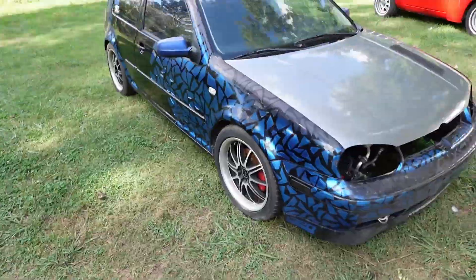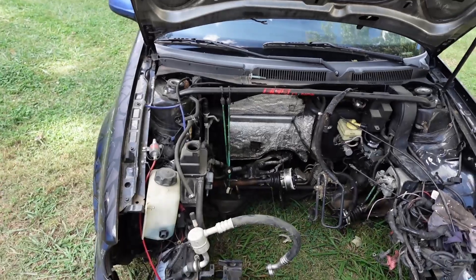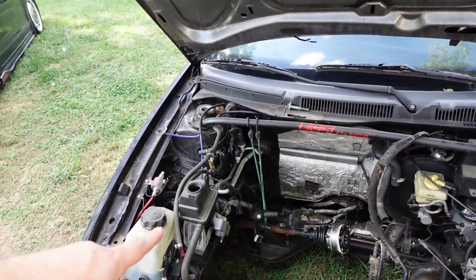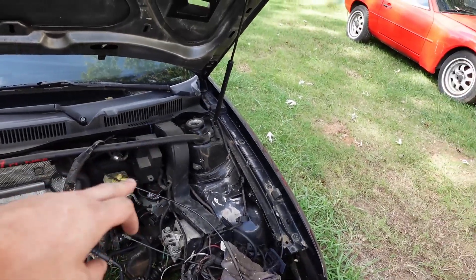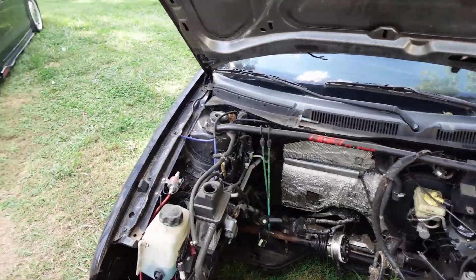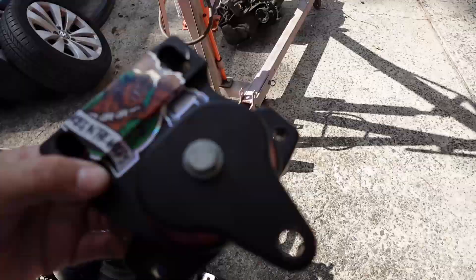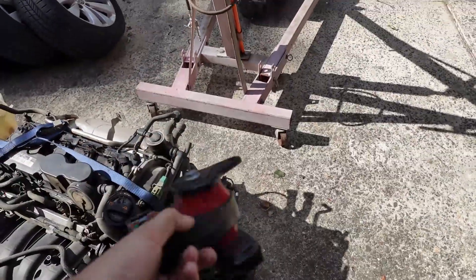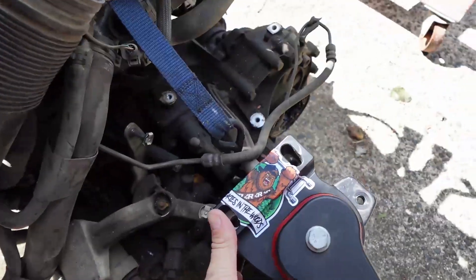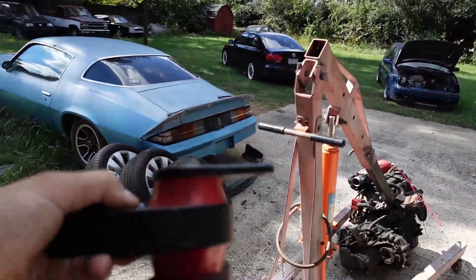But today we're going to start on this car. I want to get the engine dropped in and I need to get the mount swapped out because I've got both mounts. This mount has to change for the 2.5s, and I have a transmission mount I want to put in there — that old one's just kind of janky. Let's get that 2.5 liter from under that blue tarp over there into the car. So I found this trans mount at a junkyard one day — it's a trans mount for a Mark 4. Thankfully the Mark 5 trans mount is the same for the five-speed, so this is the trans mount I'll be putting in the Golf. It's a poly mount.